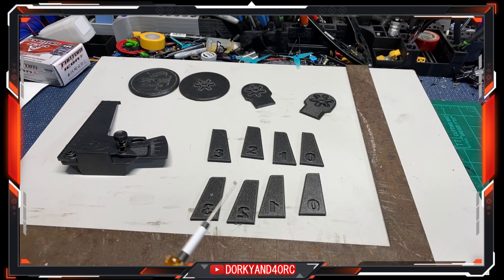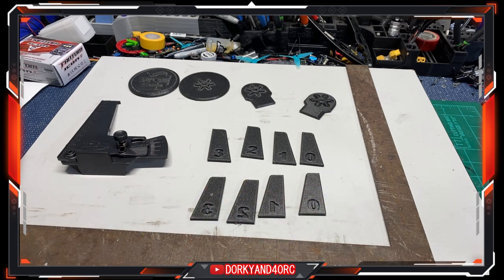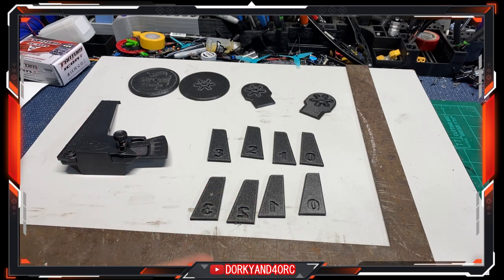Just a nifty kit that Tim has put together to help dial in that toe. Of course we're not doing anything on the rear, but if you had adjustable arms you could do it — he's going to give you rear adjustment pieces as well. So there's your fronts, left and right, zero through three degrees. And don't forget about that Low-C bar. RPM makes these too, and they also make a toe adjustment, but the thing is really cheaply made and wonky. This is to me a lot more of a precision-type device to do that, next to using an actual setup station. But again, the setup stations just aren't going to work for our applications — the toe bars just aren't big enough and they're just not going to fit.